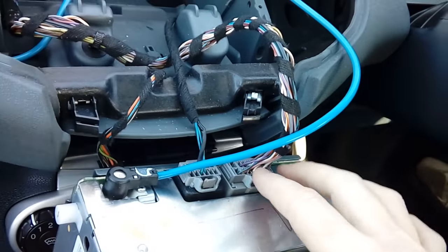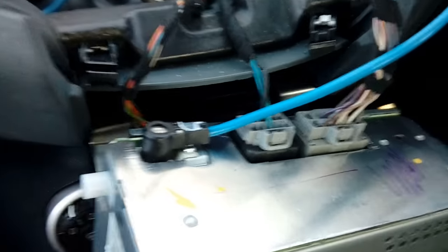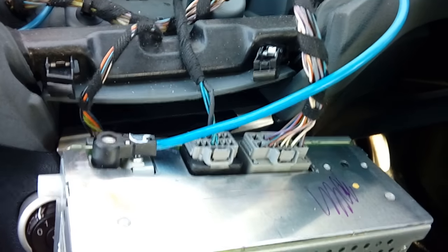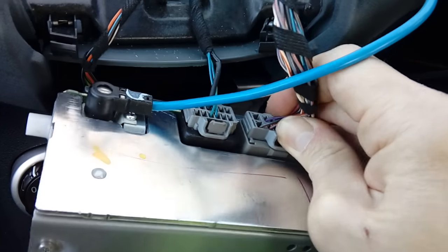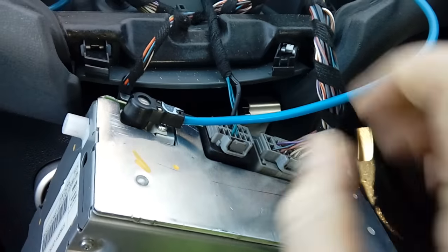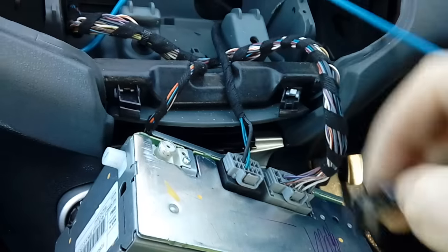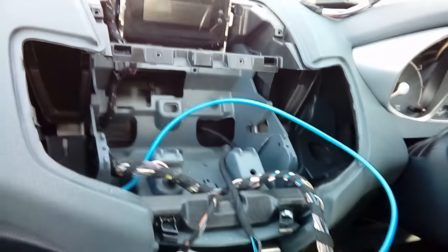This particular one is exactly as I predicted — it's going to be using the SOT-938. So if you're fitting a hands-free kit and want to use the same brand of adapter, SOT-938 by Auto Leads is your one for this car. If yours looks like that, SOT-938 is your hands-free adapter cable. All the connectors are on squeezy tabs — just squeeze and pull, which is quite tricky to do with one hand. Pull your aerial connector off as well — squeeze and pull.